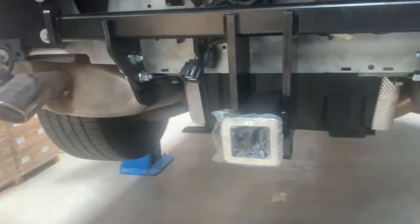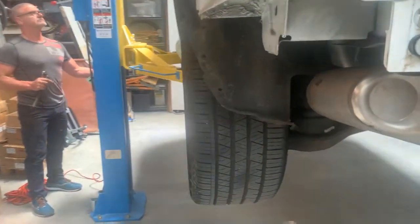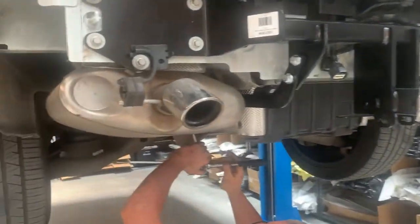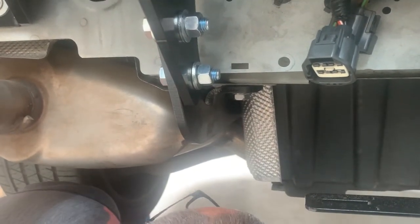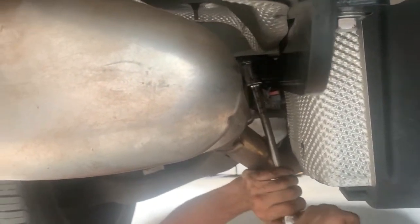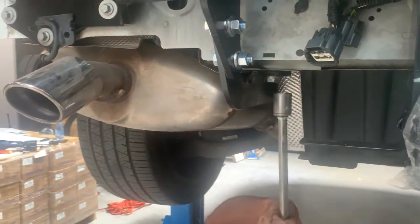We're going to work on the bottom ones — these are 18mm. We're going to get under the car and you can see you can't access this part from above. The same principles apply: you're pulling it in and you're adding a fabricated steel piece of metal. The chances of it being dead accurate are probably next to zero, so pull it in nice and easy and tighten it up, working your way along.